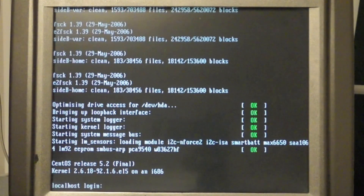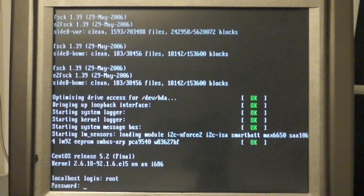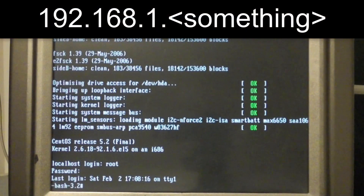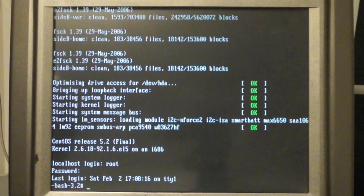So you have to know what your network addresses are. Log in. Often, in home networks, the router is going to be — the network is going to be an address of 192.168.1.something, or something like that, 192.168.0.something. It depends completely, but that's where a lot of the default home networks are set up. So you have to know what your network is.